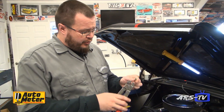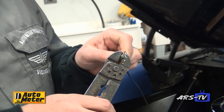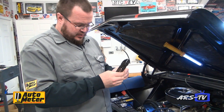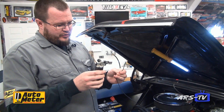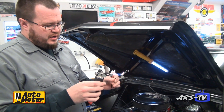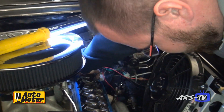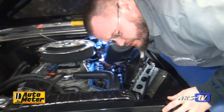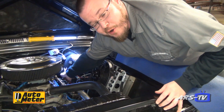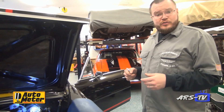We've got a ring terminal on our ground wire — we're going to crimp this together. Dave had this really cool terminal that has the heat shrink tubing built right into it. We've got a nice crimp there, nice and solid. We'll take our torch, get that nice and warm, and we'll have a good, nicely insulated connection. We're going to take a bolt, stick that through, and use one of the accessory bolt holes on the back of the cylinder head. Got it just about there — using my trusty breakaway elbow for torque specification, and we are good to go. We'll pop the valve cover back on, our gauges are properly grounded, and we're just about wrapped up.